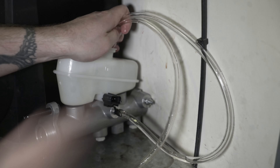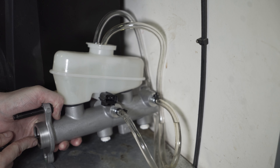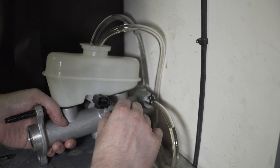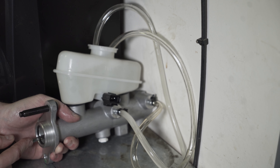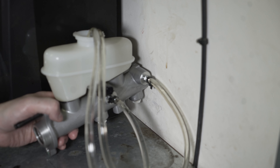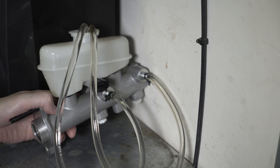It is highly recommended that you use a strong vise if you have one — I did not. Bleeding the master cylinder is a very precarious process. The best advice I can offer is to push the plunger slowly and release it slowly. The reason being is that when you push fast, you're actually getting air in the tubes, which is the opposite of what we're trying to do. You can even see that the plugs I was given aren't really holding up — they're leaking, which makes getting air out of the system all the more difficult. After you gently and slowly push in and release, wait a little bit before you plunge again and see if the little bubbles will pop and settle. After about 20 or 30 minutes of doing this, I decided it was about as good as it was going to get and went ahead and installed it.